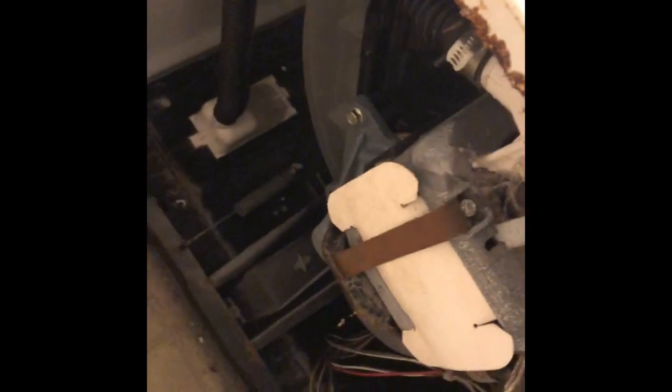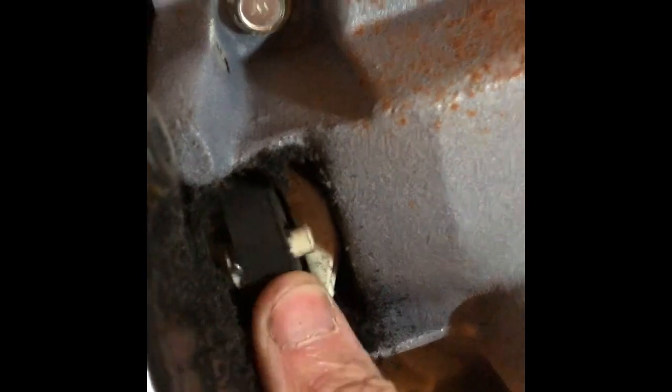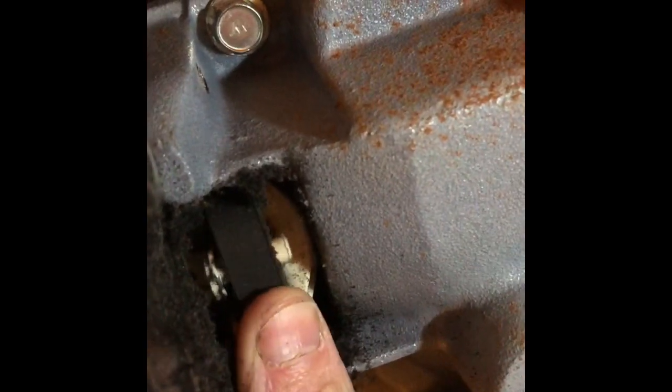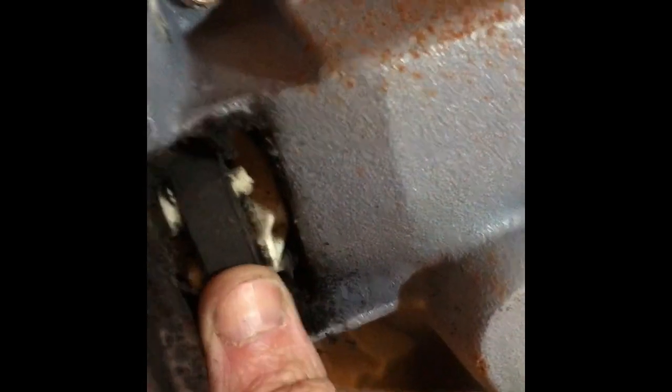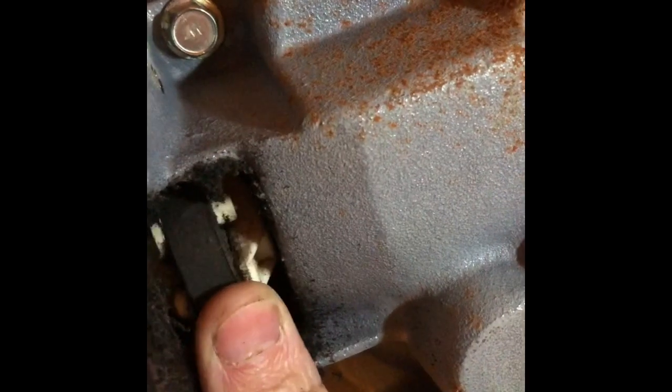So I'm going to take a pretty fast approach. I'm just going to pull the machine away from the wall at maybe 2.5 feet and lean it back to about 45 degrees. This is the motor coupler, and this one is loose and wobbling around, and that shouldn't be the case. So I think part of the plastic is cracked. To replace it, we're just going to take the motor off, and it's pretty easy to do. This is a really cool machine, easy to work on.